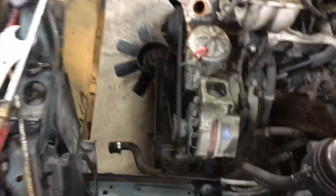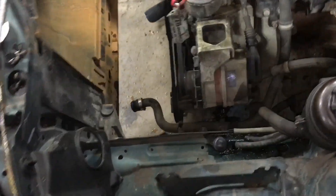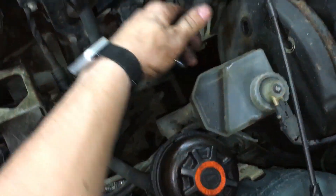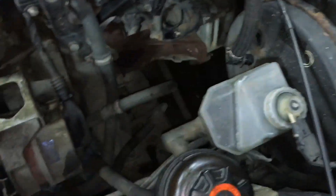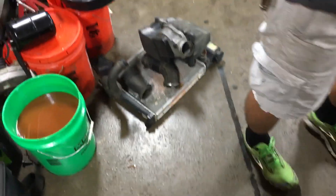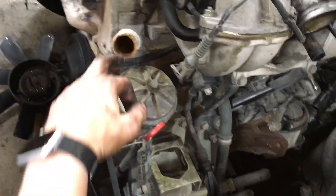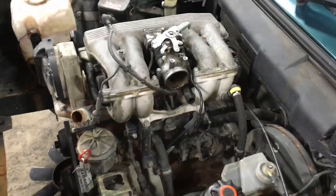There's a whole lot of extra room when you don't have the two extra cylinders. There's definitely a little bit of a coolant leak, but everything's coming apart really nicely. Fuel lines came off, vacuum line, airbox and whatnot came off really nice. Even the rubber was in pretty good shape. Really no complaints except for clearly having run straight water instead of coolant in it.